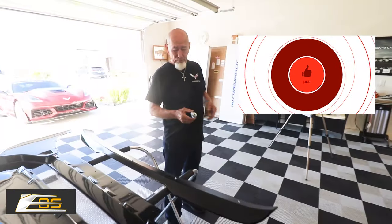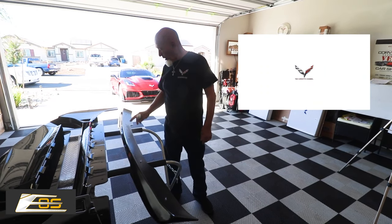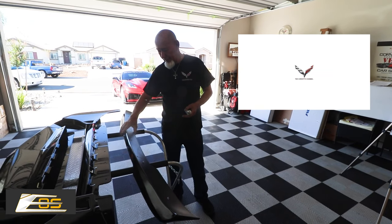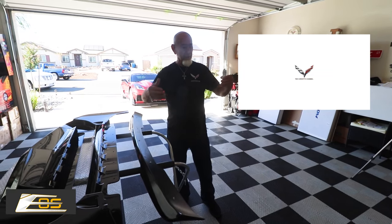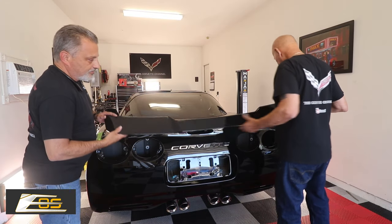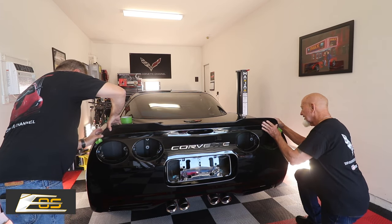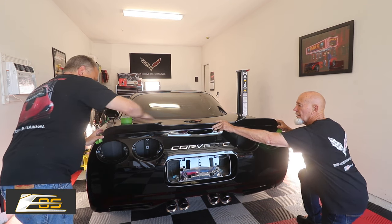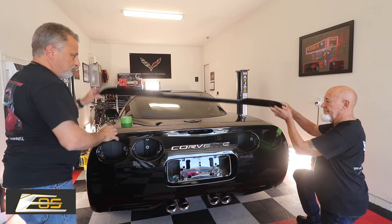Now with Scott's help, we're going to go over there - he's going to help me from side to side and we're going to set that down. When we set it down, it's going to leave these little marks and then we'll drill the holes. Drill the holes a little oversize because that gives you a little adjustment - don't go so big that the nuts fall through, just big enough for wiggle room to line it up on the body. Just lift straight up and there are your little places.